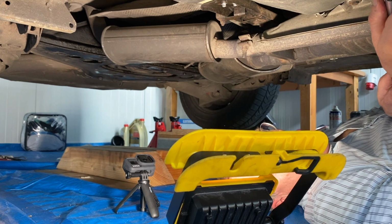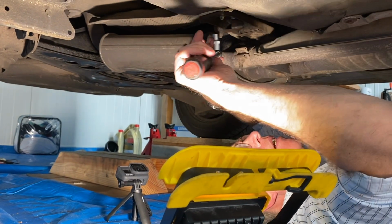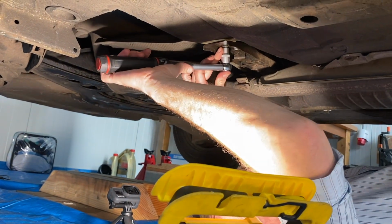So here you can see that we welded the bolts onto the metal. So we are back in the race. I think everything is ready to bolt the bracket to the body. Great. The torque needs to be on 24 Newton meter.